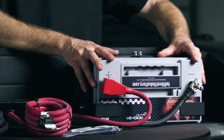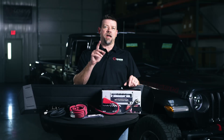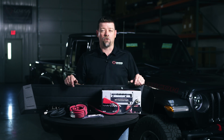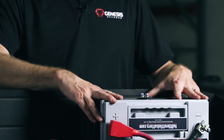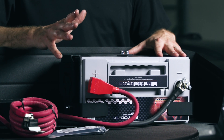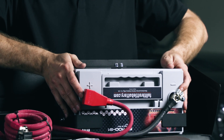One of the nicest things about putting the dual battery system under the back seat is you have more options for your batteries. Not only do you only need one battery, you also don't have to throw out your factory battery. So you're only buying one battery with this system instead of two and keeping your factory battery. Here we've got a Group 31 — this is the biggest battery on the market today for vehicles, and this is a 120 amp hour battery, so this is a big one.